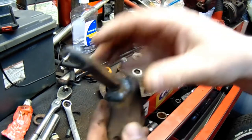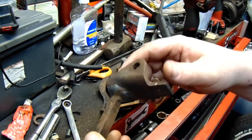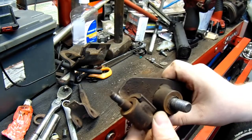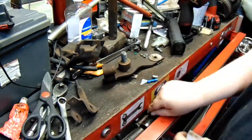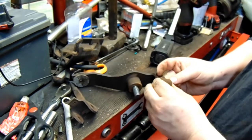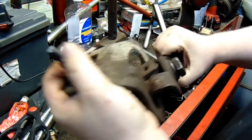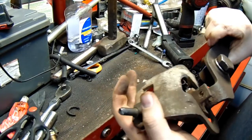Because I had to grind so much out of here, I laid a weld around here and welded right here, then just ground it down flat. The hold is probably minimal, but it's better than nothing — that was a nice hot weld; I don't think this is going anywhere. You can see how much I got to take up right here. I got an idea for a bushing — let me see if I can make it work. I think that just might work. There's not a lot of wiggle in there now. That took quite a bit of the slop out. I'll consider that done for now.